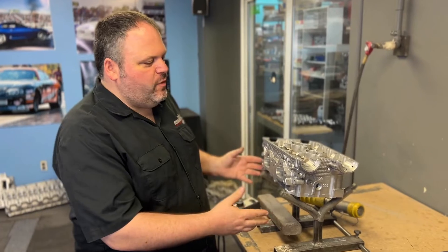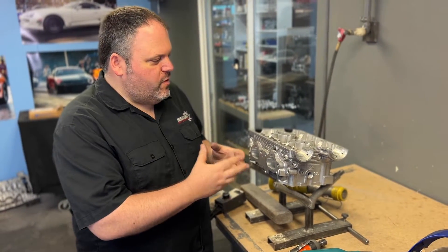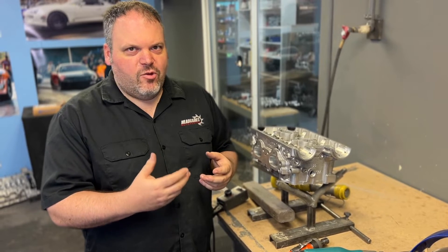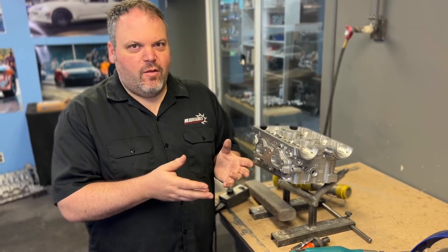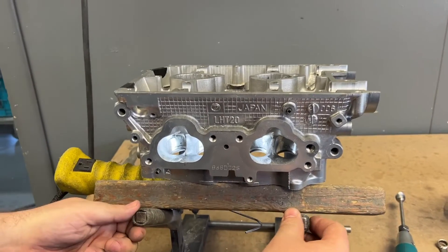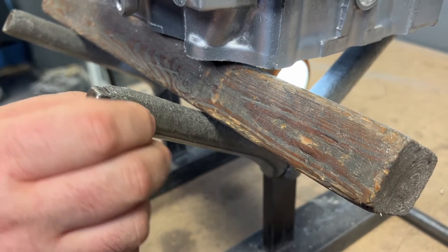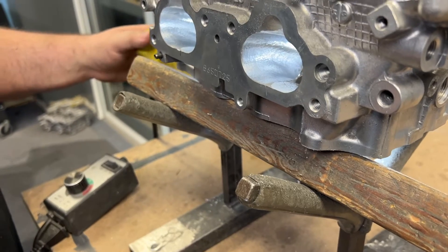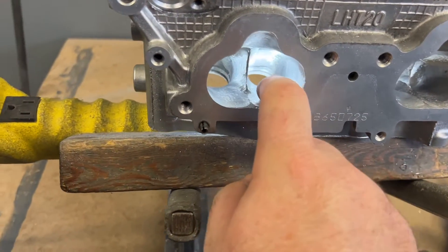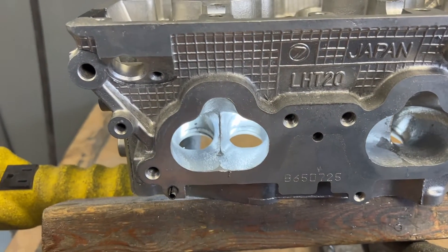Now the only thing that's left is setting the cylinder head up so you can successfully grind on it. I see guys putting the cylinder head in really awkward positions and grinding in awkward positions. I would say bring the work to you — if you can't naturally make a shape right with your hands, you're putting the head in the wrong direction. For example, if you're going to port the floor and the walls, I would prop it up like this. We have a little stand — you can buy these at Goodson. I put a light underneath it. This way you're porting the floor and the walls, not up here. You're only porting this area and you're good to go.